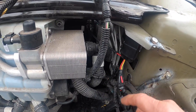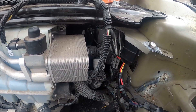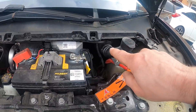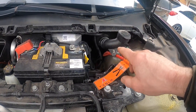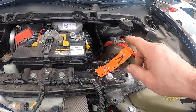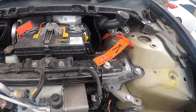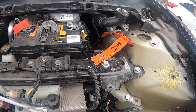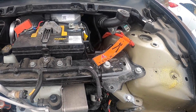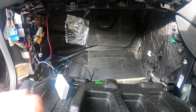The tricky bit is there's quite a big wiring loom which goes from the relay and into the car. There is a grommet tucked away on that bulkhead — it's so far down I'm never going to be able to show you — and that's the one I use to go into the car. It then goes down to a series of switches, which I'll show you in a moment, and then you have to wire in the CAN interface, which I'm going to show you now.